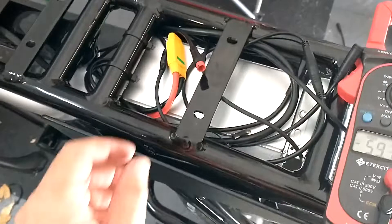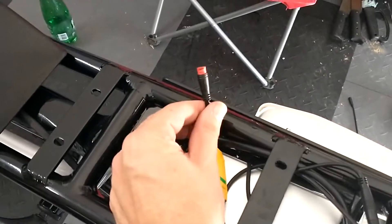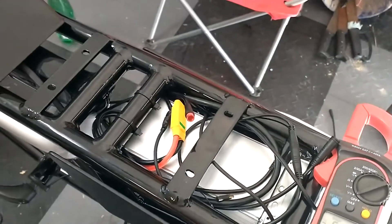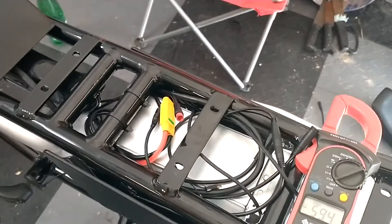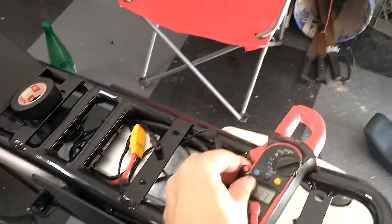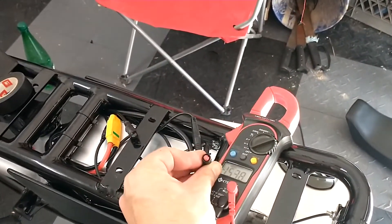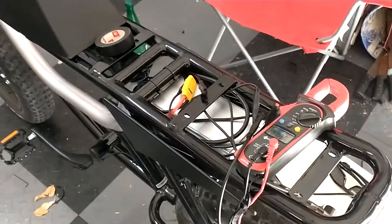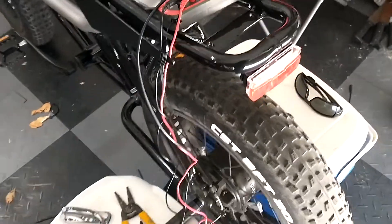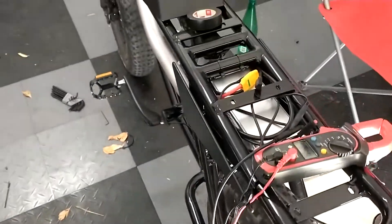I didn't fry it, but I don't want you guys to, so don't use this connector. I'm going to tape it up and move on to one of the other two pins and see what's going on with those. Both of the female reds pull five volts when the bike's on, so I don't know what those are for — nothing on the Anza though. I need 12 volts for the light, so looks like I'll be without a headlight for a little while to figure something out.